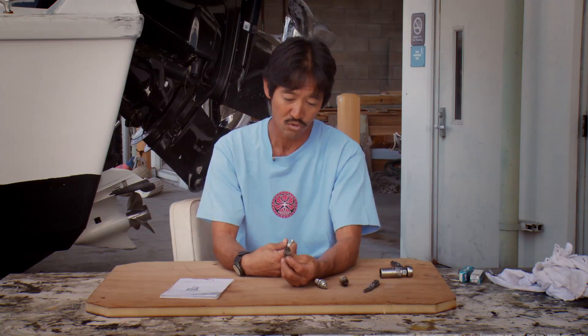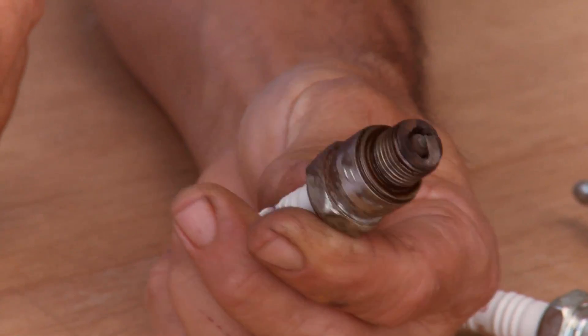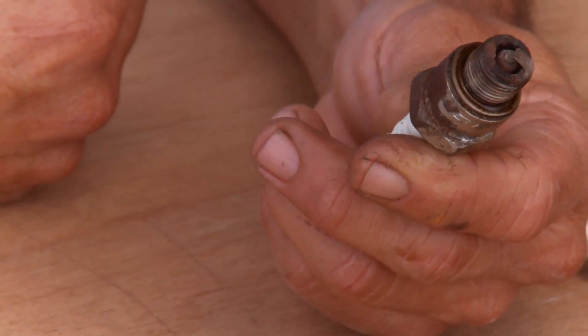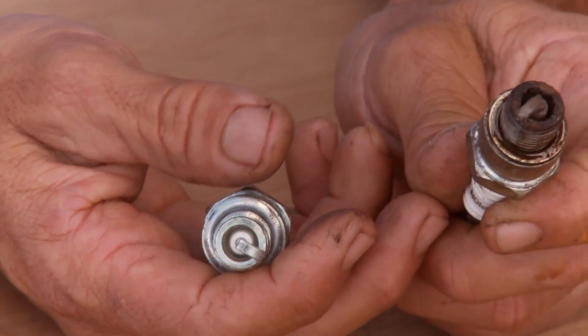That's one of the major reasons I feel that power packs will pop or blow — it's because they're running old plugs, way over the time they need to be changed. On this older two-stroke of mine, about every hundred hours the plugs need to be changed, besides obvious corrosion reasons. That's about the life expectancy on the older ones. The newer ones will probably double, maybe even triple that.